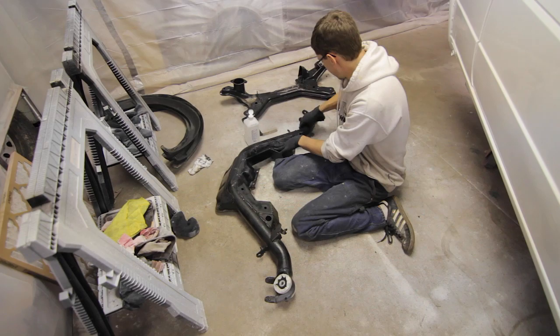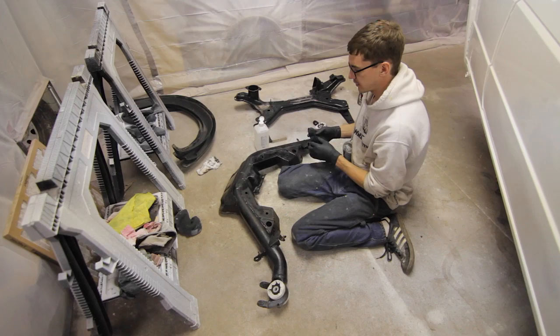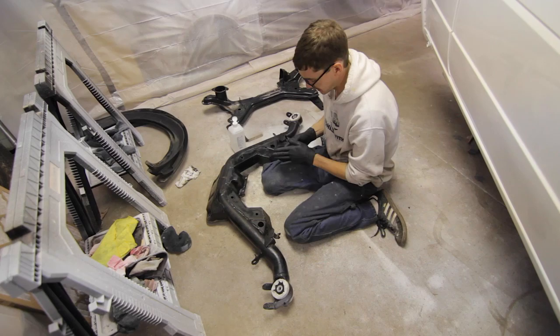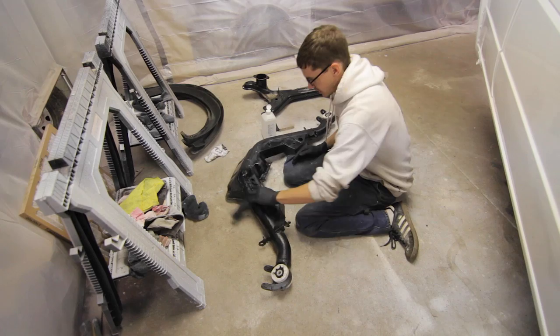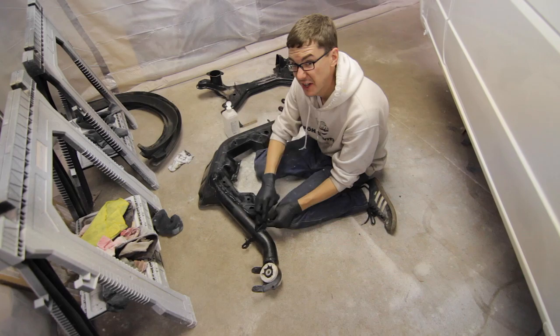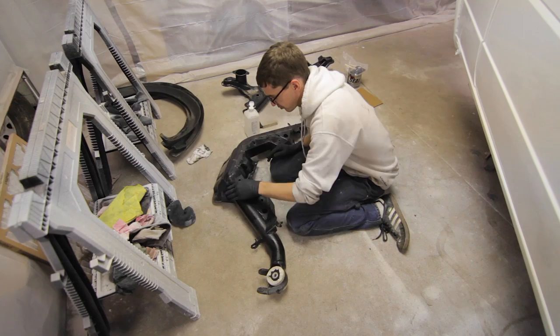And then there's another product, oh man, now I can't remember what it's called, but it's the top coat to go over that stuff to make it more durable, because apparently Rust Seal by itself is not super durable. I was talking to Mark Eby, and he said, oh yeah, I ran that stuff in my subframes and it just flaked off immediately. So just doing some looking around, I think the solution is to get a better top coat to go on top of it. But that's good, because once the prep's done, you just brush it on. It's not a huge big ordeal like this turd.